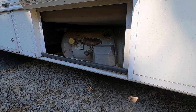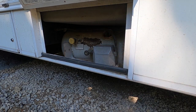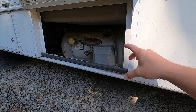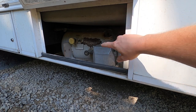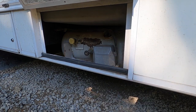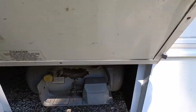Like most motorhomes, I have an onboard larger propane tank. If you have a travel trailer or truck camper you'll probably have one or two 20-pound tanks like a grill would have. These are a little bit bigger and meant to withstand an accident — a bit thicker — but basically the same setup: you have your tank, your valve, and under this plastic here is a regulator. There are a couple of things that may confuse you when working with propane.